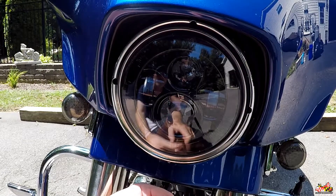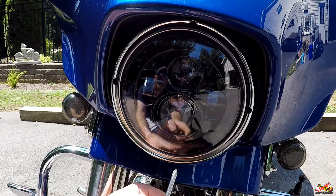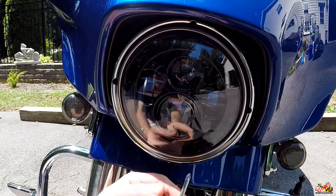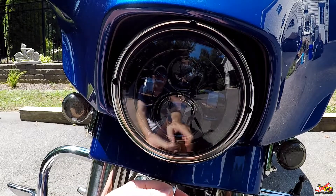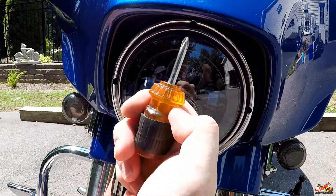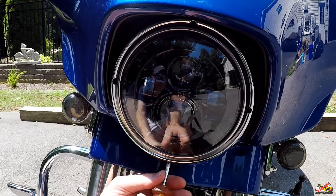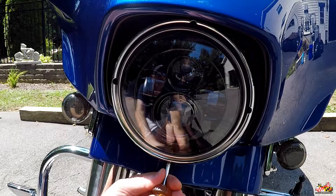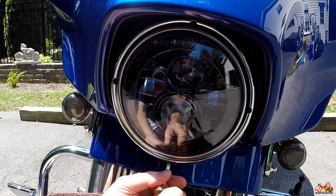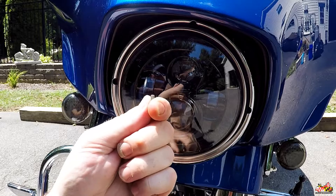This current light on here is from Eagle Lights. While it's a solid light, there's one thing on it that really irritated me — I'll show you when I do the nighttime comparison. So the first thing you want to do is take off the outer ring. With your Phillips screwdriver, just pop this little screw out. Learn from my mistake when I changed my light from stock: I lost this screw and it took me like an hour on my knees to find it. So unscrew it and put the screw in a safe place.